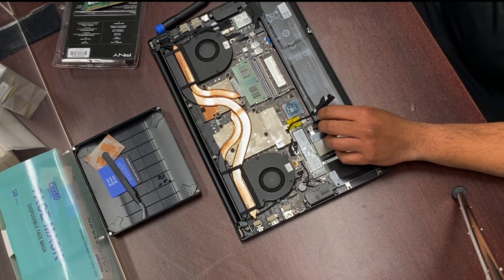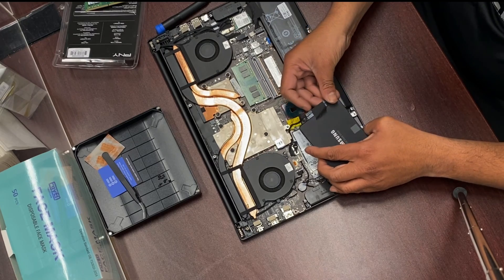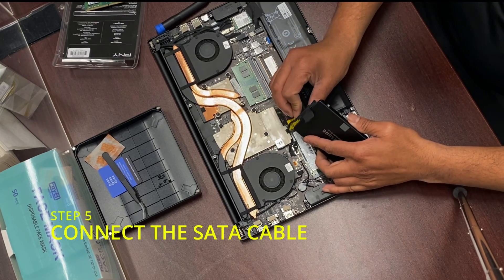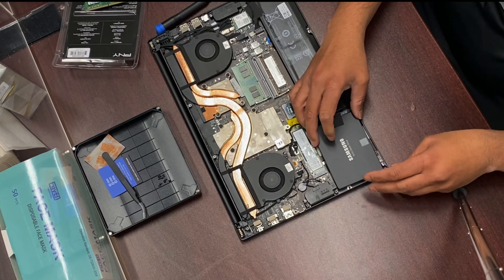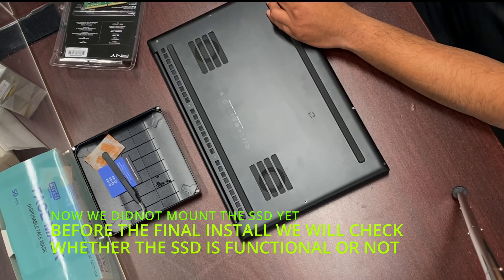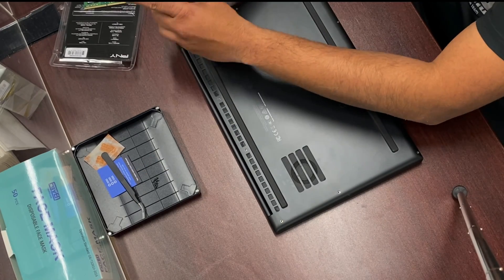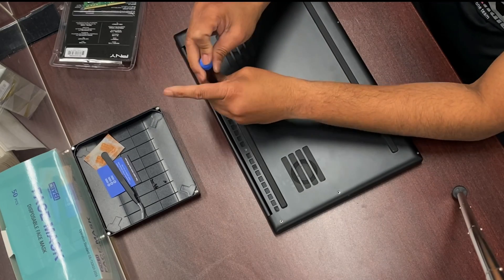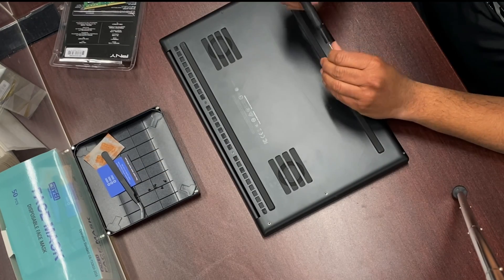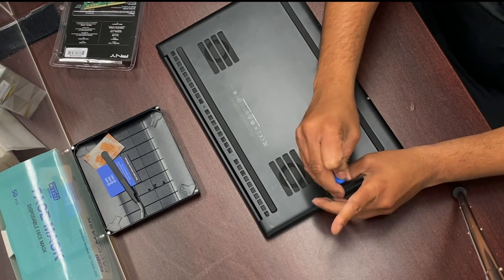After I've separated that SATA cable, my job is to make sure the drive is actually working. I'm going to gently push the SATA cable inside the SATA slot, and after I've connected that, I will just tape it back again. This is just for testing — later on I'm going to fix everything properly. I'm just going to test whether the drive is working and whether my system is reading the 16 gigs. I'll put like three or four screws so the back cover doesn't fall out, then open the system and check.